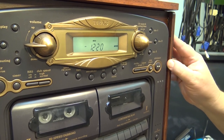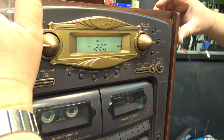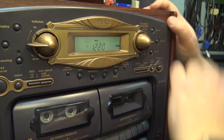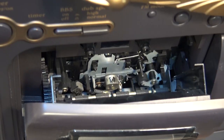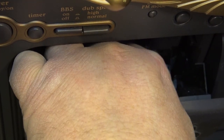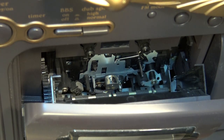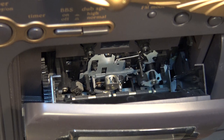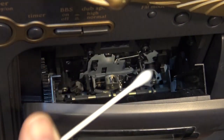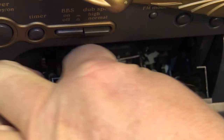You can see how cheap this thing is — the wood cabinet isn't even glued together properly. Looking at the cassette head, it has a bit of wear; I can hook my fingernail on it. Check out the erase head — there's so much dust on there that I don't think this thing has ever had a tape recorded on it. In this case the erase head is just a fixed magnet.